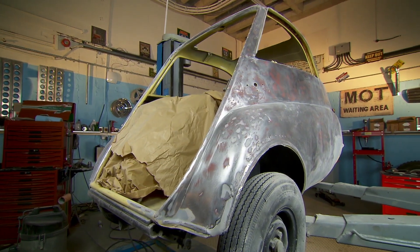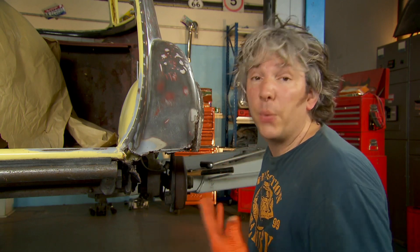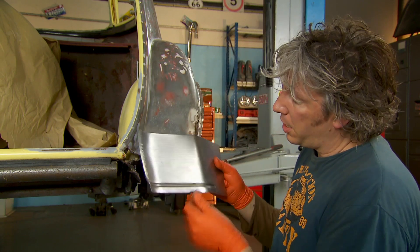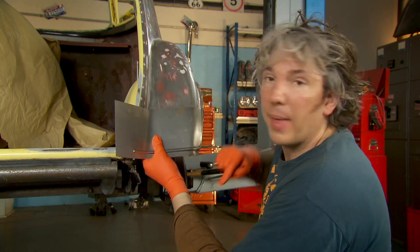The wheel arches are only part of the jigsaw. I'm also going to repair the lower wings, which have seen some abuse in the past. So before I cut any bad metal away, I still need to know exactly where I should be cutting. Luckily some of the original beading is still here on the original bit of the car, and of course it will fit quite nicely into the new beading. By offering all this up, I can see exactly where I need to mark that line.